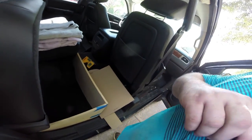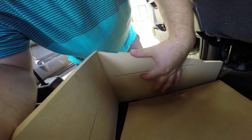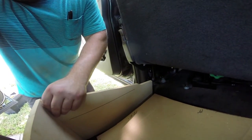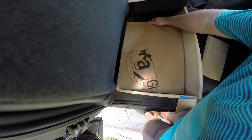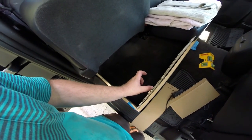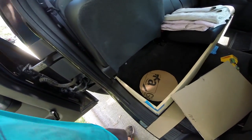After some thought, here is the game plan. We're going to build a large rectangular enclosure that's 13.5 by 19 inches, and it's going to sit right here as the bottom shelf. I know what you're thinking — how are you going to fit a subwoofer in there? Well, here's the genius of the plan: we're going to use an inch to inch-and-a-half piece of MDF to space the subwoofer down, since we've got lots of space underneath this line for the subwoofer to chill. This gives us enough volume in a nice squared-off box that's easy to make.